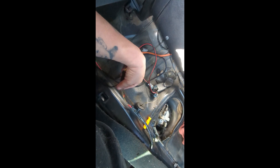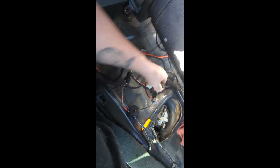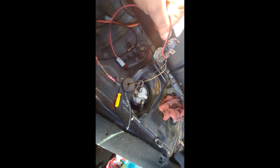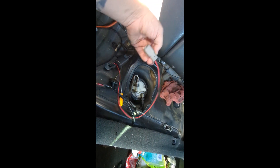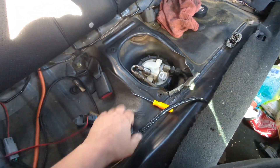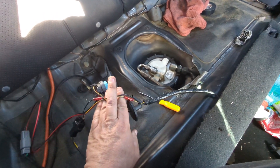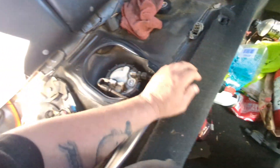So the yellow-blue is for the signal and the other wires are for the fuel gauge to tell you how much is in the tank. Pretty straightforward — go ahead and clip that back down. Once you have that pinned, take the red and black and connect it onto the relay. Right there — connected. This is the first step of getting the wiring part done.